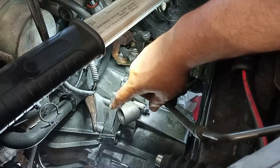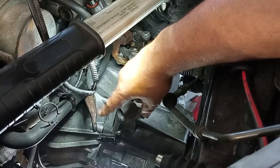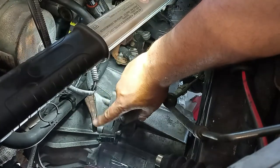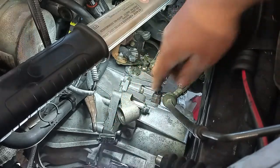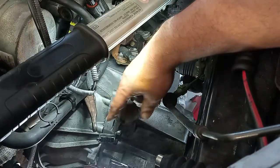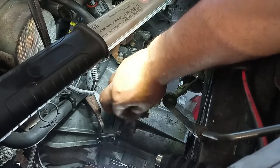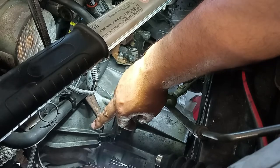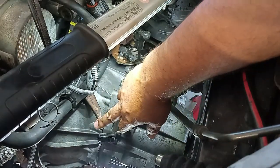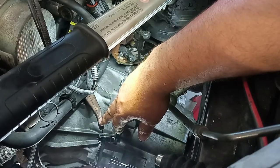Okay, now comes the most critical part of this whole operation, because if this does not work correctly, you have to remove the gearbox again. I'm talking about the push bearing. So it's time to engage it, and what I usually do is move it to touch the pressure plate, and then do a very sudden movement to engage the ring clip that is inside of that push ring.